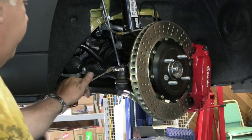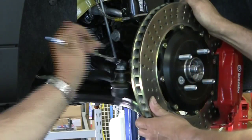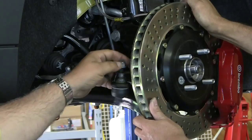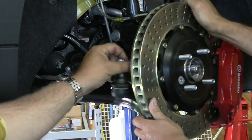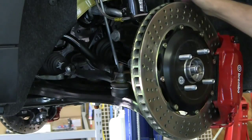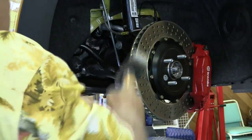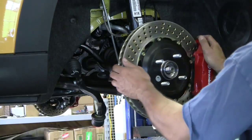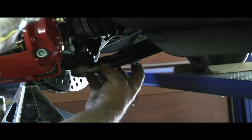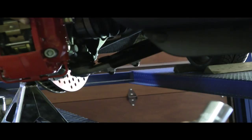Let's disconnect this steering arm knuckle. Alright, viola - we've got to knock that down. And there we go. Remove this lower control arm. We're going to take these two nuts off that hold this bracket on the lower control arm. What do we have here? 21mm.